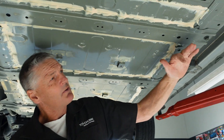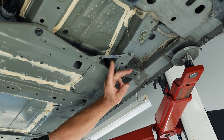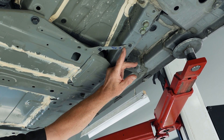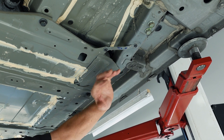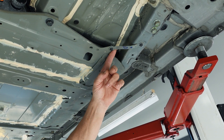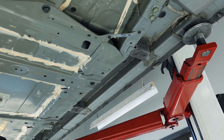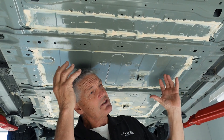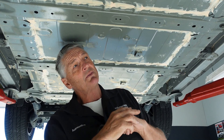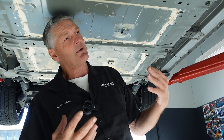On all these electrical systems they have special earthing straps. They don't look like much but standard electrical practice is to protect anyone who touches the vehicle — if there is a short circuit they provide a path for electricity to pass through into the body rather than through the human body. This battery unit is totally isolated inside from the electrical system of the normal car body, so the risk of electrocution is very, very low.